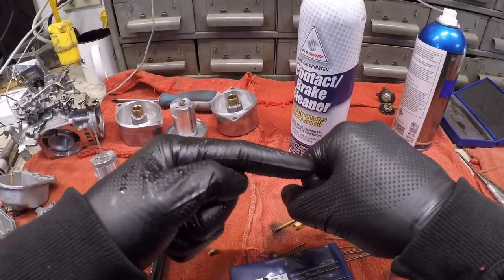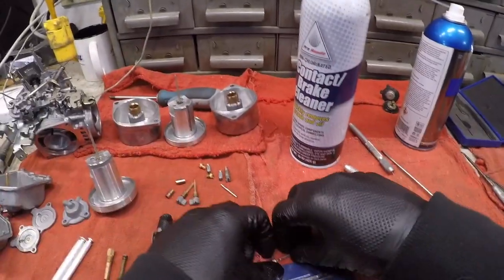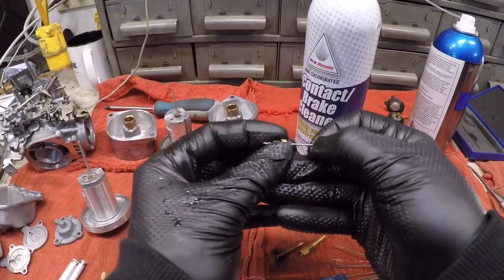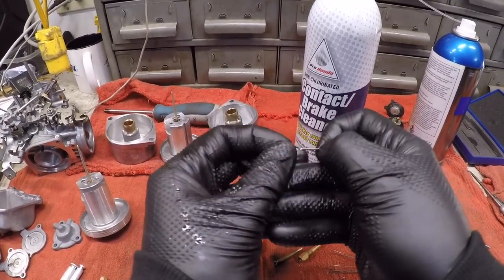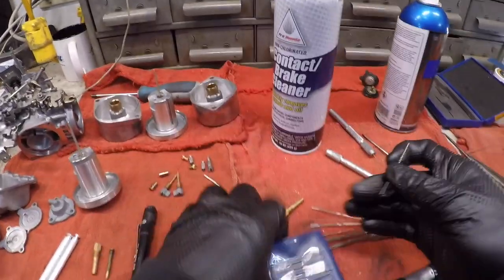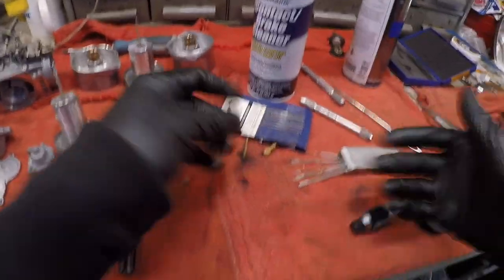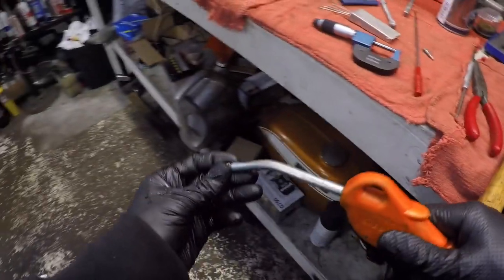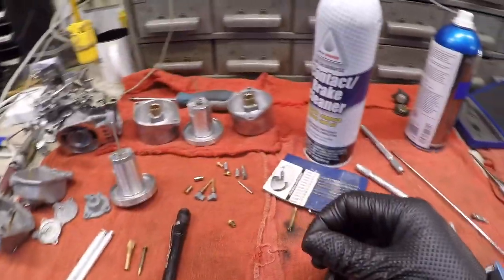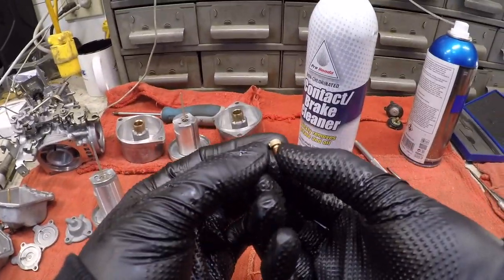It's not like a little bit larger of a thousandth or a hundred thousandth. You know, it's exactly the same size, so they won't fit exactly right. But you can take a 118, and that's what I like to do on idle jets, because it opens them up just a slight hair, and I think it helps them out. But again, it doesn't matter really that much. It's just a great way to check to make sure that, let's say you put the carbs back together and it still runs crazy rich, and you say, okay, well, this is a 110 main.